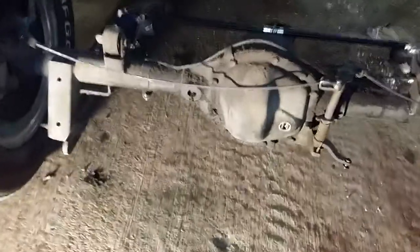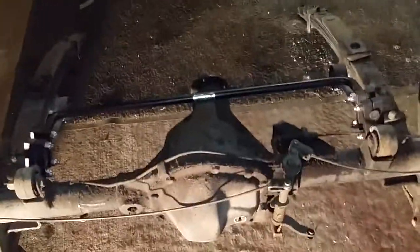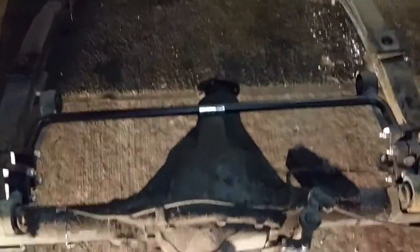This axle normally carries tramp rods — hence these fittings — but these have to be redone. This axle also has a Harvey Bailey anti-roll bar. The problem with Harvey Bailey anti-roll bars is that they move; these come loose and the bar slides forward and can hit the cross member and the fuel line attached to that cross member. It's this edge here that then crushes the fuel line.